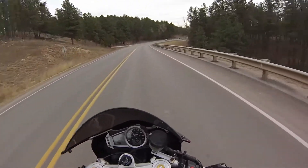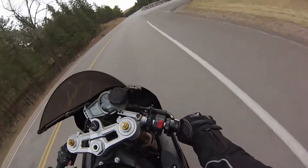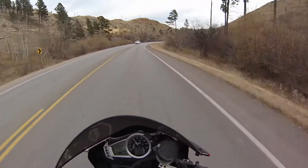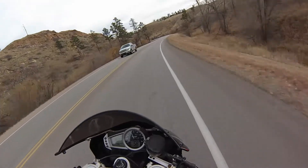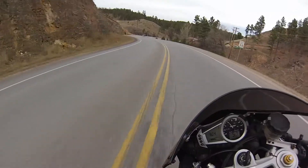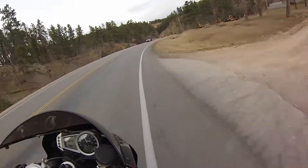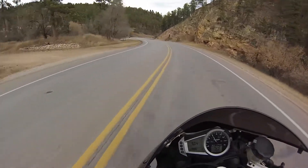The sixth and final thing you want to do is either put your bike up on stands — like I will over the winter — or put a piece of wood under each of your tires. Putting your bike on stands protects your tires from moisture from the ground and also protects them from getting flat spots from sitting in one spot over a long period of time. If you don't have stands, just put a piece of wood under your tire — it'll protect it from moisture and it's a softer material so you won't flat spot your tires as badly as if they were resting on concrete.